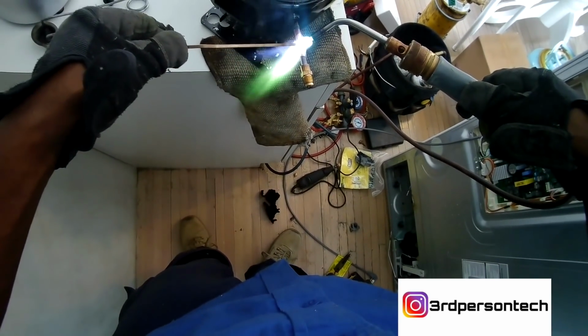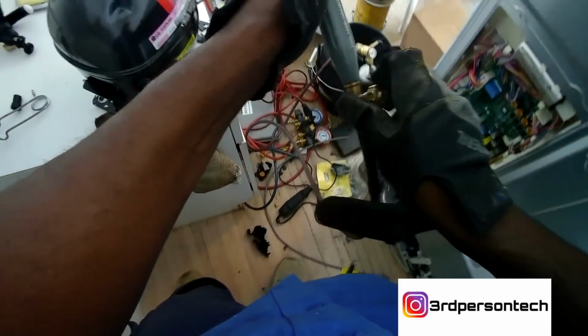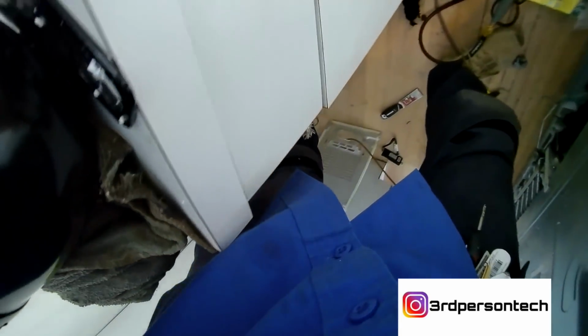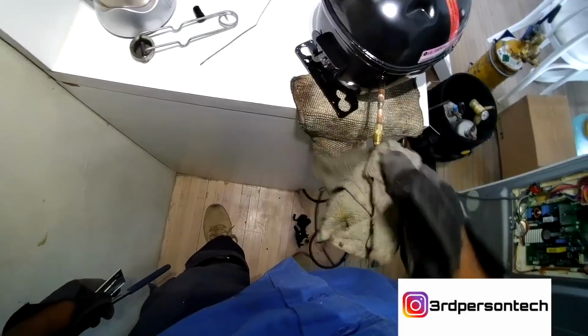Let us continue. All right, so I cleaned up the line. I like putting on my process tube first on my compressor, and I like putting it on when the compressor is outside. That way I don't melt the connection socket in there, and I have melted that connection socket a couple of times, guys. So these are just bonus tips to save you some trouble.